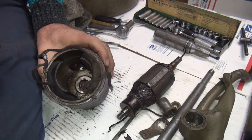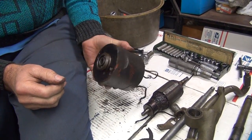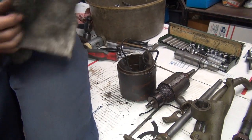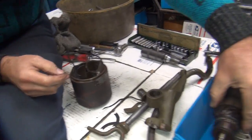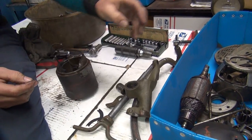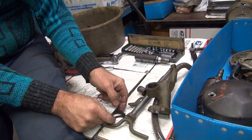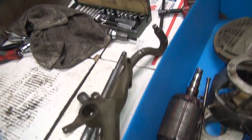See how that plate had the seal in it? It's riveted together — it has a piece of felt in there. Once the felt is worn out there's no sealing it. But when you put a new sealed bearing in here you'll knock 90% of the oil out. For time and labor and parts on this it's going to be prohibitive. Everything needs to be worked on — this is all bad. We'll make some decisions on what we're going to do. It just comes down to whether you actually rebuild all this stuff for a rider — if it's going to be a rider, it's not that important. Mine's going to be more of a rider. Let me go grab that other generator real quick.